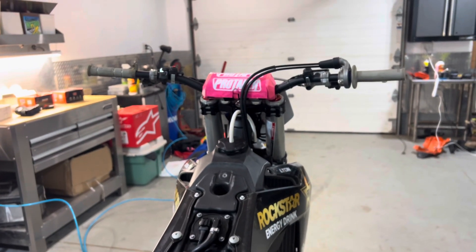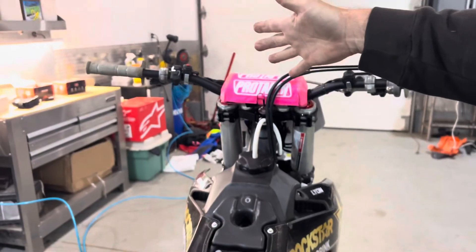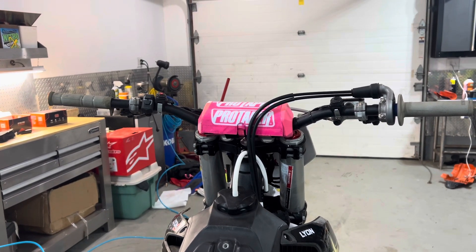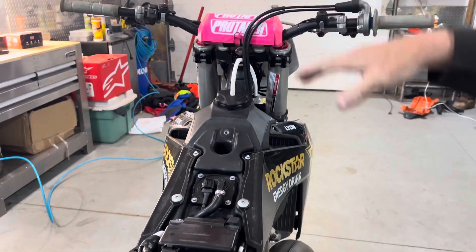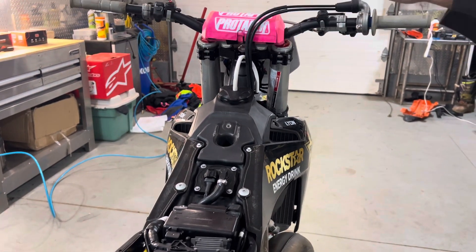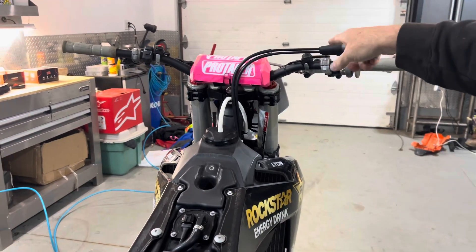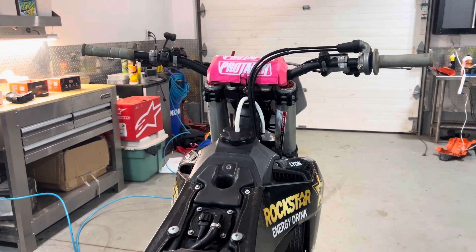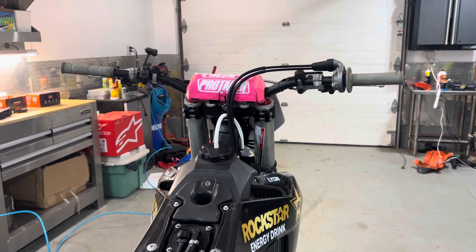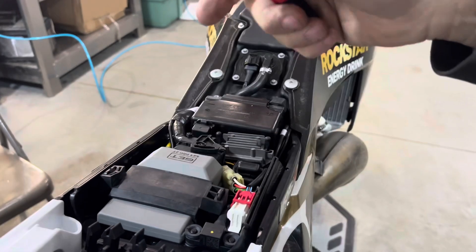So we just learned something together: when you plug in the wake-up connector to reset the power valve, it defaults to white every time. You saw it click off. Don't be surprised if you unplug the wake-up connector and that light stays on — if you don't start the bike for an extra minute or so, it may take about two minutes for the light to finally go off. Don't be super concerned; it's not going to stay on all night and drain your battery.